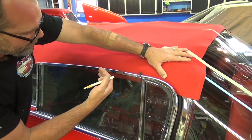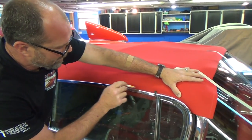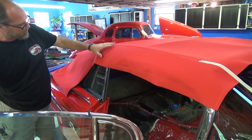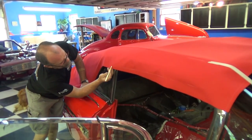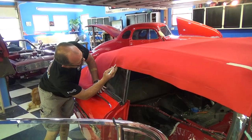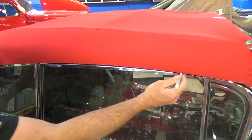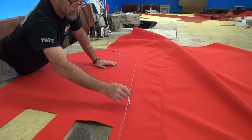I've opened the door and brought the convertible top frame and glass frame to the outside, so I know that the top has got to clear that door opening and shutting without hitting the top. The least amount that top can hang down is this far. I'm going to go ahead and mark my window all the way back — I can't take that back window out, so I'm just following it with my fingers, feeling where the frame is, and making a little mark down through here. We get all this trimmed out so the window goes right underneath it, and when I get my binding on there all you'll see is that chrome — you won't see any of the rubber or anything behind the top.